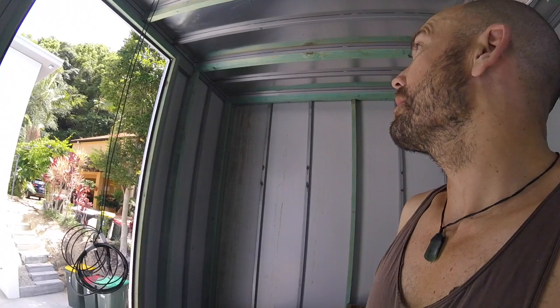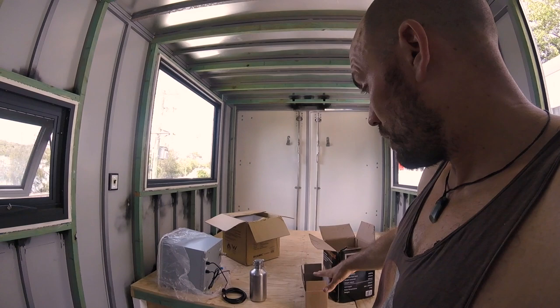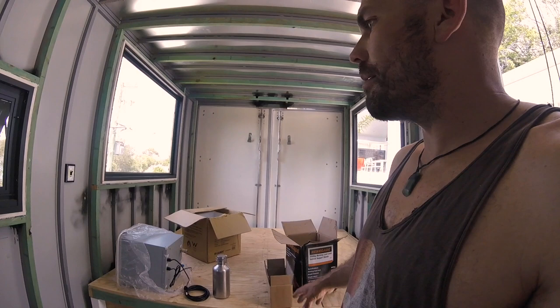There is also going to be another cable running all the way to the top there that is only going to be connected to Shore Power, so it'll never run off the electrics and the solar setup inside here. That's just future proofing it if someone wants an air conditioner, or if we find we want one, but I don't really plan on putting one in. Another cable down the right hand side, and it's going to come down here. There's going to be two sockets in the kitchen, and two sockets in a charge drawer that we're going to have. And that's pretty much it for 240 volt.